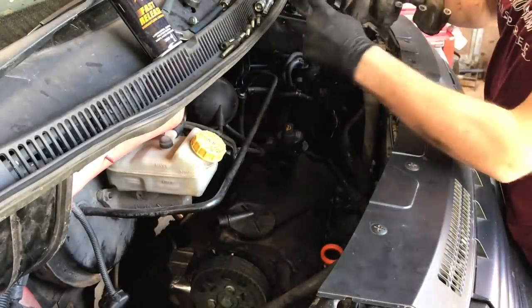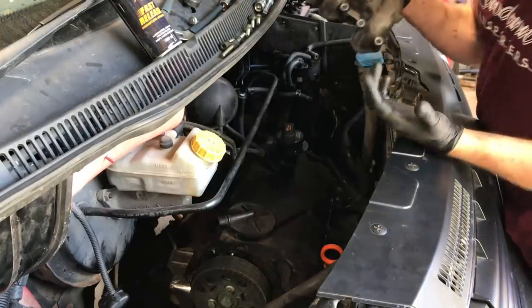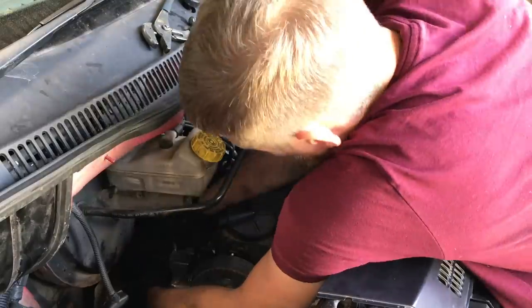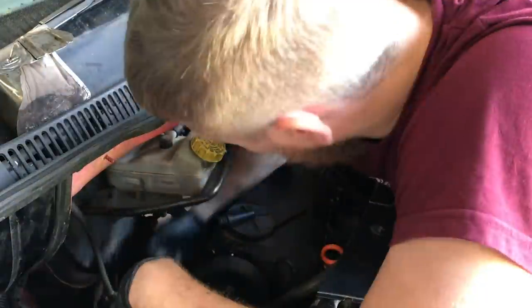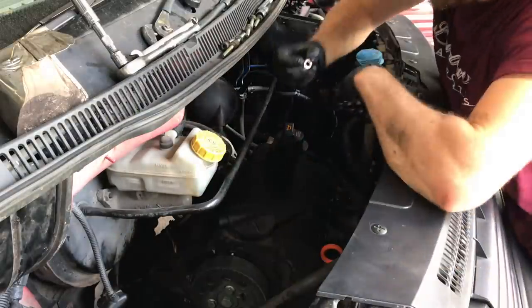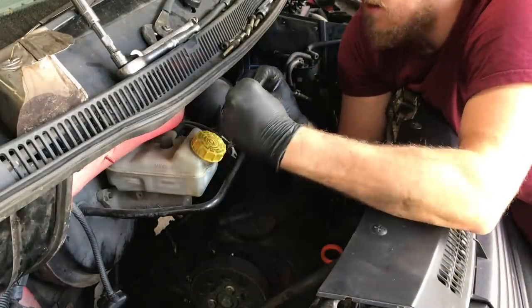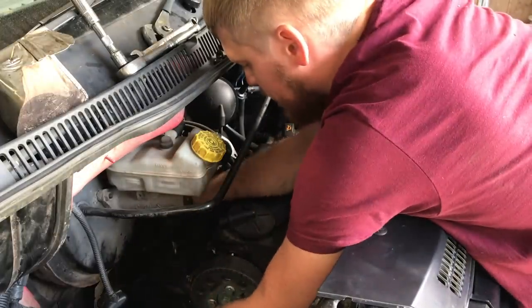There's the inlet manifold off. On the back of that you've got six bolts that go into the block — one more bit off. On the exhaust manifold you've got eight nuts and what look like brass washers as well. I'm surprised they just undid, but they actually aren't too tight, so we'll whip all these off now as well.